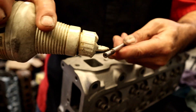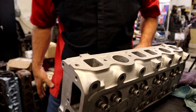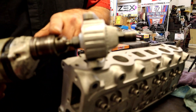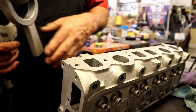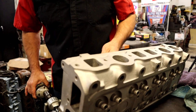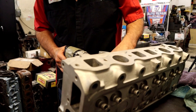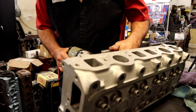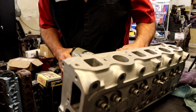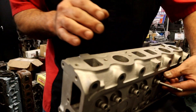I'm going to put a little bit of cutting oil on it — use any kind of lubrication that you want. This is a speed reducer so as it turns, this runs at a different, slower speed. If you don't have a speed reducer you can just buy the knurler and slow down your drill. You're going to see it come out right here. All right, so I've just knurled the guide.